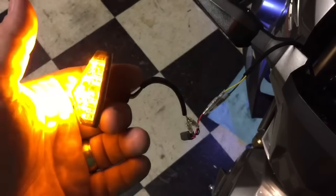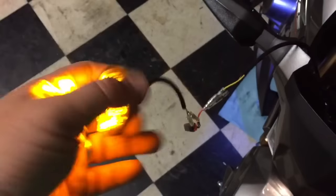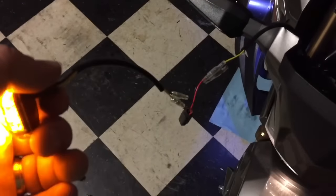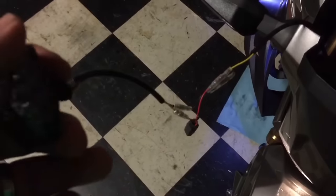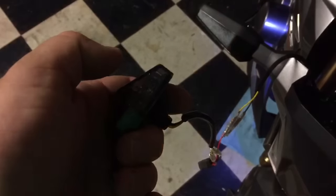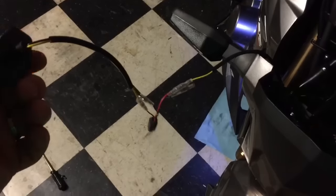Here's the blink rate based on the resistor being installed — that is more acceptable than it was. Oh, that's blinding! So that's just jabbing a resistor in line. I got these at work. Sure slows these guys down — that's what you want: a nice, smooth blink. And holy heck, those suckers are bright. Don't look at them. Anyway, it works much better.